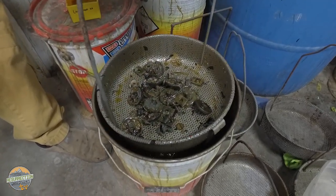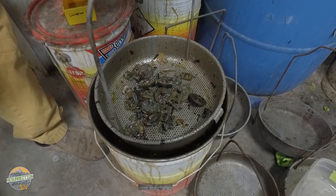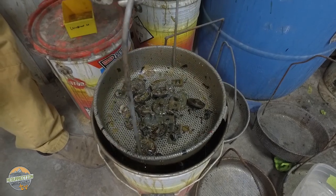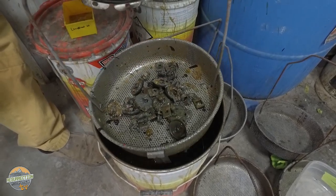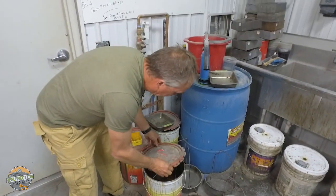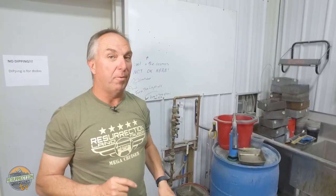That is going to remove, these are bolts that hold an inner fender onto an outer fender. And they've already begun to, I think these went in this morning. Most of the paint and liner and rubberized undercoating that were on them is almost already off. So once they get processed that, they get rinsed, and then they go into the Evapo-Rust.